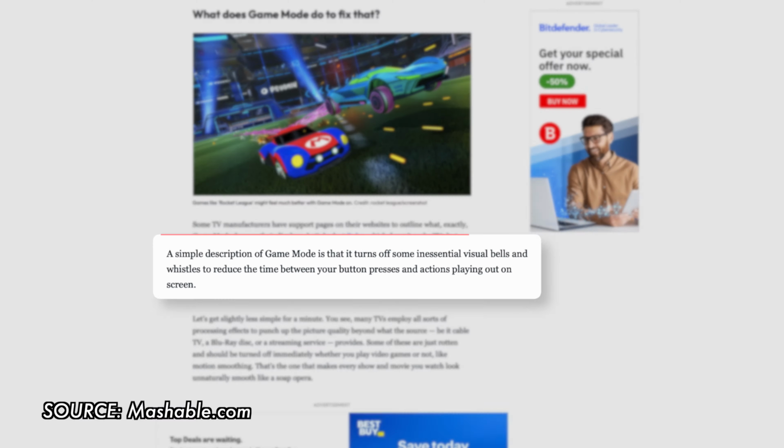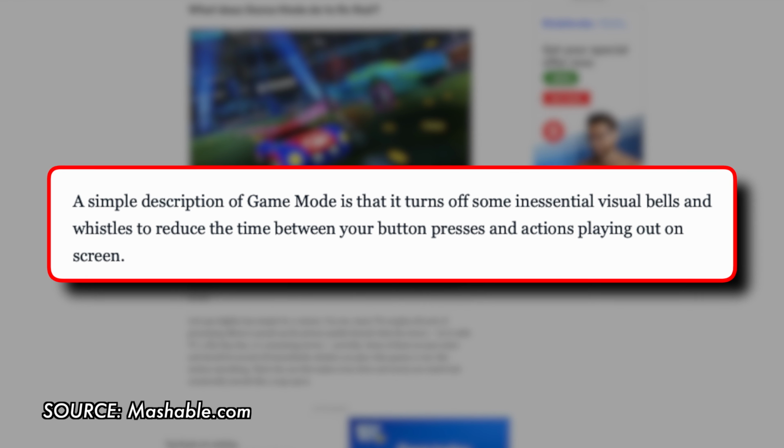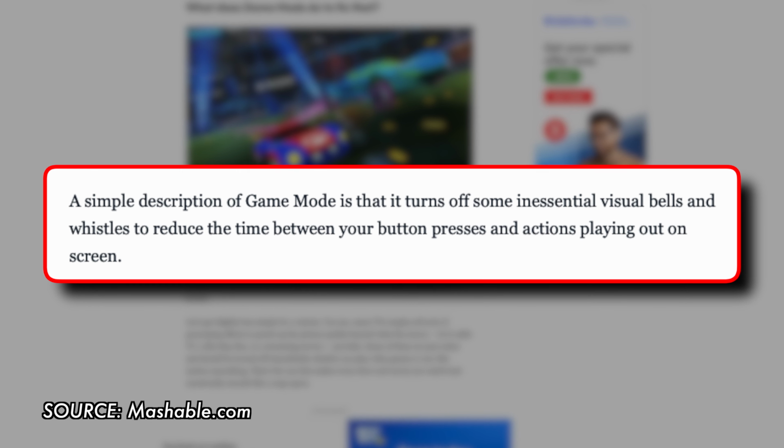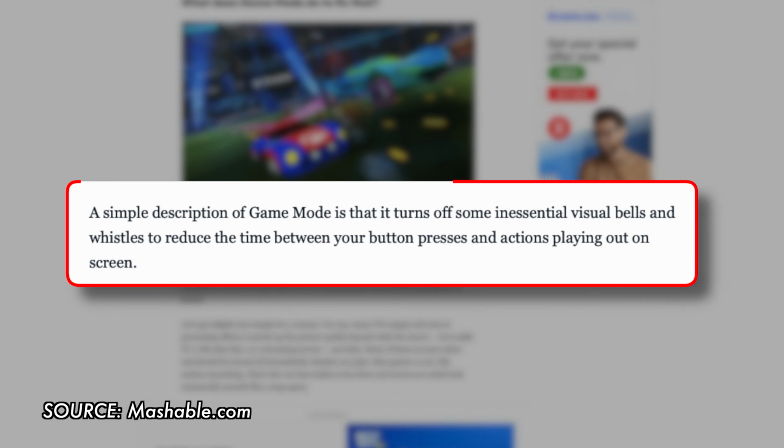That's awesome. Now, if I want to use a game mode setting, what would I have to do at that point? Would I just go to game mode and copy it over to the custom picture? You could do that. Where you have to be careful on game mode, and I don't know on this TV in particular off the top of my head, but the whole point of game mode is to reduce as much latency as possible. And when you start going in and making adjustments, there's extra processing, so the latency is not as good. So there are some displays out there where, when you put it in game mode, you can't do anything to it. But if you can actually adjust game mode on this TV, you can take those settings that we made and put them in that other picture mode, and everything should be okay.